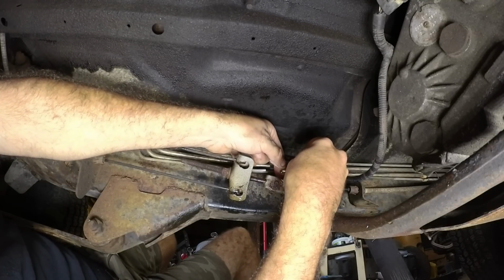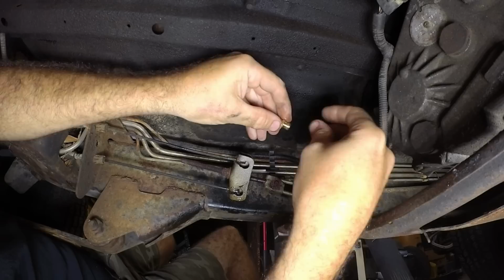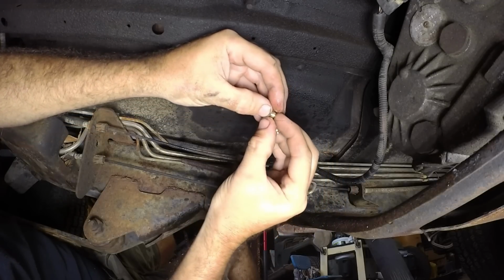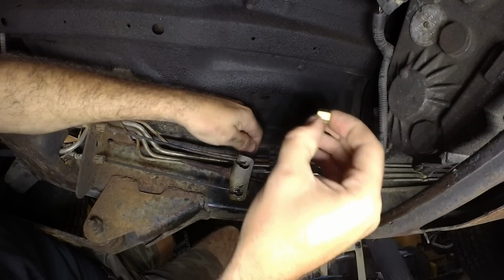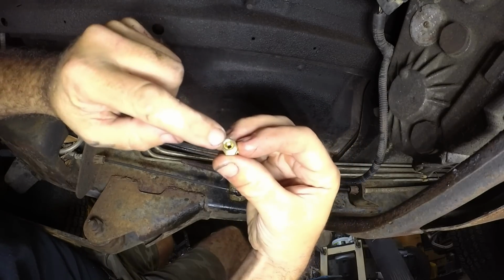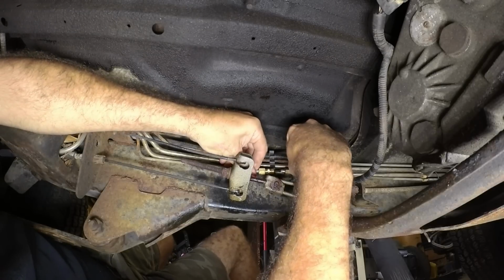So you see you put the nut on, and then there's a collar that you put on that's tapered. It then fits, but you got to do both sides. So you have this and this goes inside of this, and you slide it over the line. Bada boom, bada bing. And this has got a taper on the inside of it, so when you put it together and tighten it up, it causes that taper to squeeze onto the line.